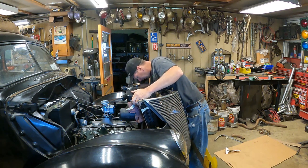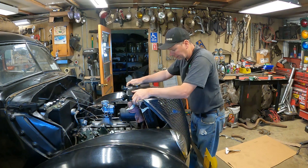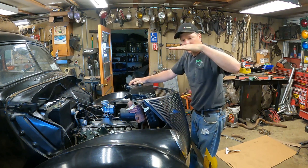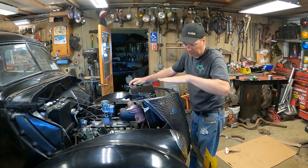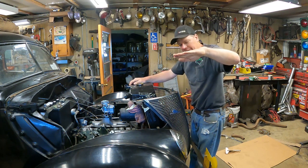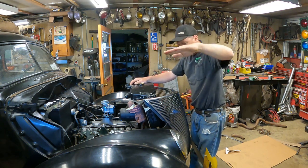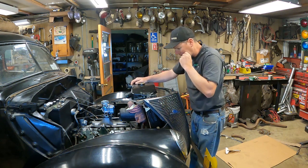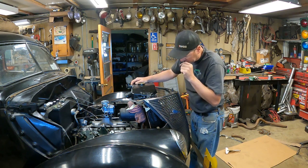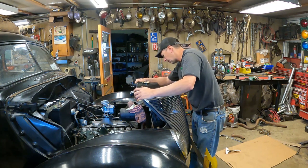See if that made any difference. The pads where the lower radiator feet sit on the frame, this car has been hit on this side. The one was tweaked up just a little bit. I tweaked that down, and actually I rolled them down even more, and then I took the feet of the bottom of the radiator and I cranked them up a little bit, try to get this thing to sink down, because I think if I can get it down just a little bit, it'll fit in here better. Then you saw me clearance the grill